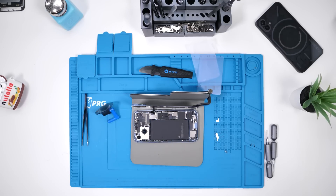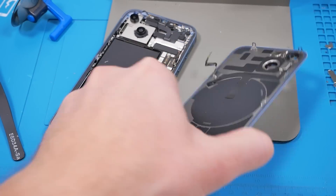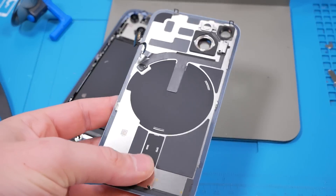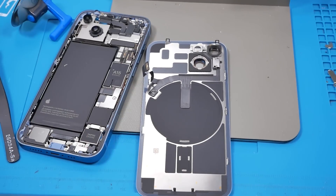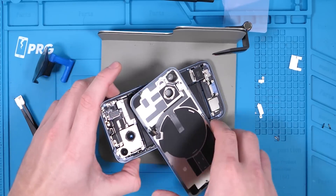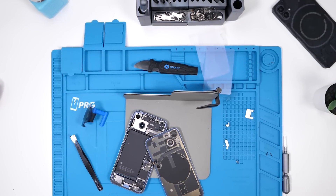I really wonder if the iPhone 14 Pro looks like this, but I don't think it does. Unscrew, disconnect the wireless charger. Separating the back glass from the actual phone would be a huge help to those who wish to repair it. Previously, back glass was considered irreparable because of the strength of the glue Apple placed on these phones. We started using laser machines to remove it, which is a lengthy, messy, and annoying process. But if back glass is now removable, it makes repairing iPhones that much easier — glass breaks and we should have a contingency plan for when it does. And this is that.